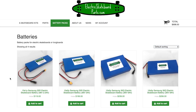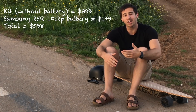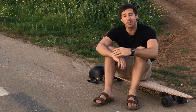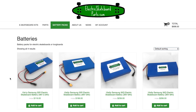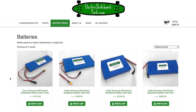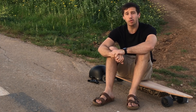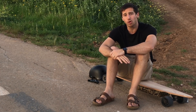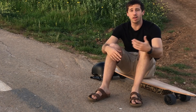In addition to that, I used the Samsung 25R battery — that's a 10S2P battery — and that costs $199. So the short answer is it costs $598 for all the components outside of the longboard itself. If you already have a longboard, you can just use that. There are also bigger batteries on the website — you can go all the way up to 10S3P with the Samsung 30Q battery, or there's a smaller 10S1P Samsung 25R battery, which is really good for a last-mile situation — probably getting you four to five miles. Using that smaller battery would drop the total price down to about $518.